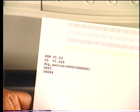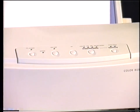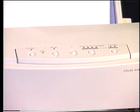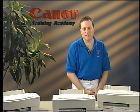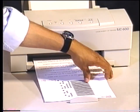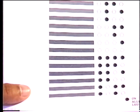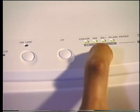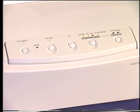If all the printhead nozzles are firing correctly, the horizontal line should look like this. If there are any missing or broken horizontal lines, perform a printhead cleaning. To perform a printhead registration check, switch the printer off. Hold down the paper select button while pressing the power button. Release both buttons when you hear the printer beep. Press the online button on the BJC-600 to start the test pattern. This registration check print is executed automatically on the BJC-600E and the BJC-610. Look at the test pattern — notice there are 13 registration samples. Select the bar with the best solid pattern. Press the print mode button to toggle between the light patterns until you see your selection, then press the online button. The black bar you choose will print out to confirm your selection. Press the power button to switch the printer off and save your registration selection.